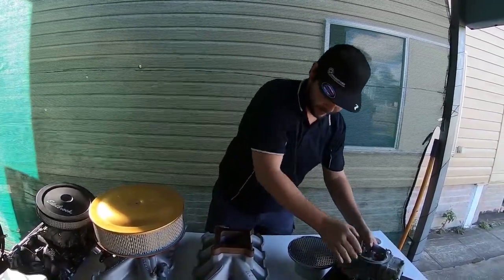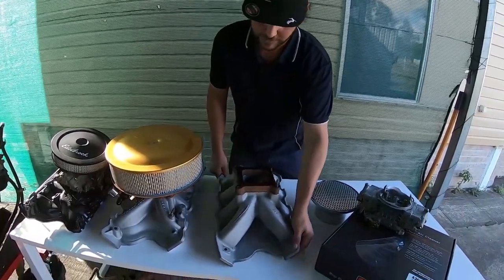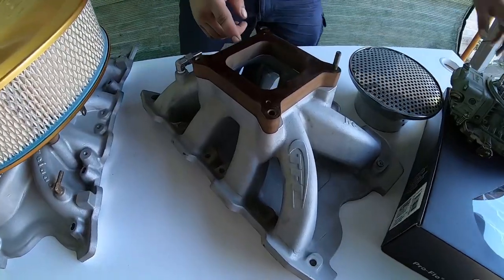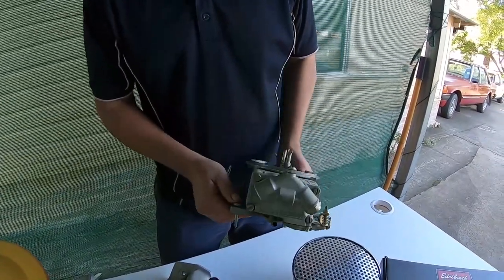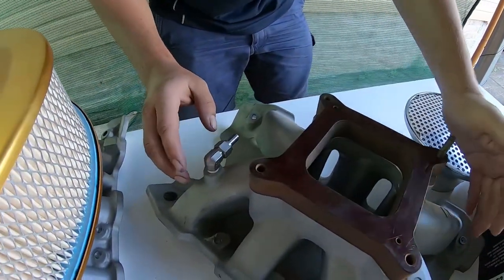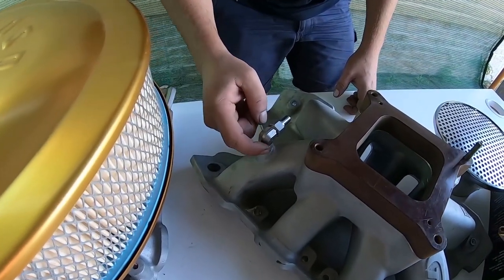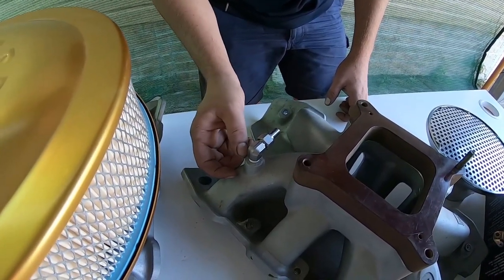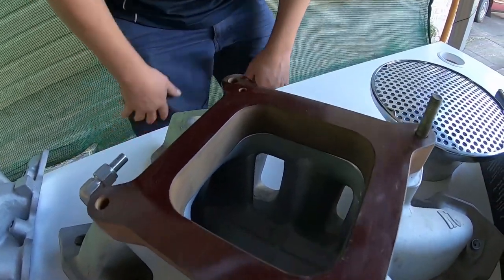With these, they're built to go — they're not really built to slow down. You'll generally run these on an engine with a huge cam that's going to have low vacuum. And if you run your brake vacuum signal to the back of the carby like most guys do, you'll end up sucking a bit of fuel and you'll always end up with a terrible brake pedal. The reason I pulled this one out is because this has a fitting to go straight to your brake booster, and it's actually ported off so it doesn't suck much fuel.